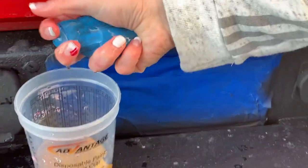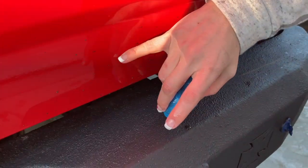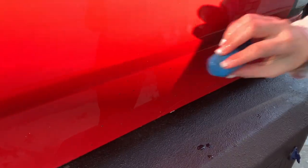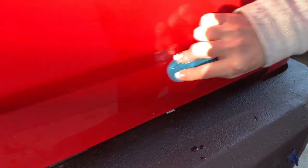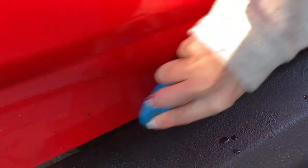This side I've already done, as you can see. But let me just show you. This made me really happy because I'm trying to nick the paint off, because these are actually raised bumps — trying to scratch it off, you can actually take off the paint underneath. But the clay won't let you do that. So you just sit and scrub in the same area, and make sure to keep it nice and moist.